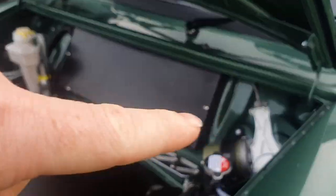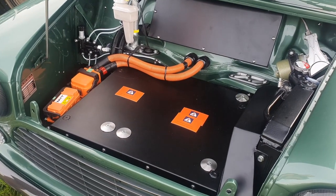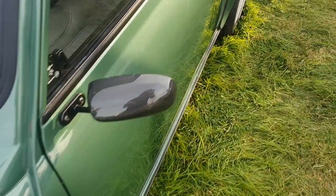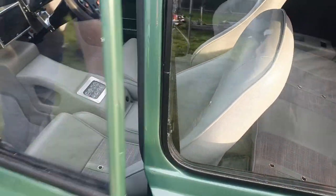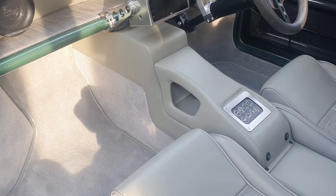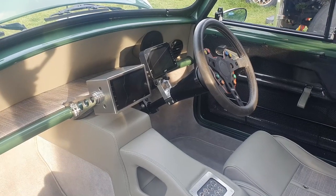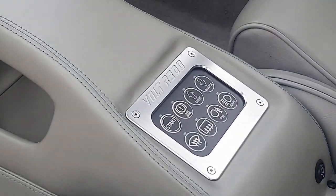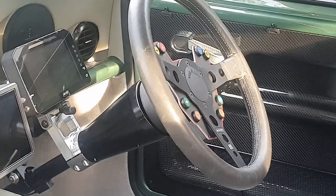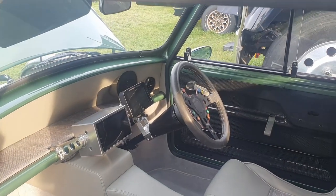So in this box — you've got two battery packs, the one battery pack and box which is there, and then the one that was in the center console, which runs down in the car. I love the controls — is it something that you guys have done bespoke for the car? It's something we've used before from a company called CarTech, which is all solid state. So it means that each switch is a switch, a fuse, and a relay, and you can program how you want them to work, whether it's momentary, latching, or permanent switching, so they're very versatile.